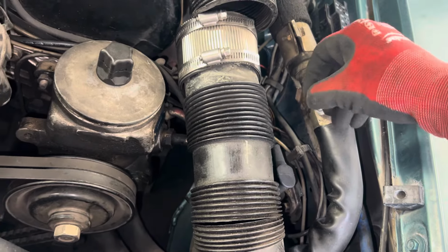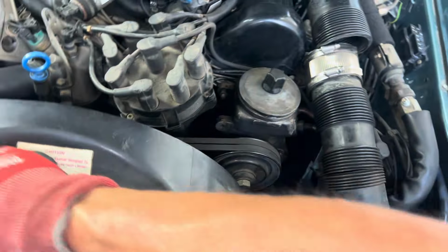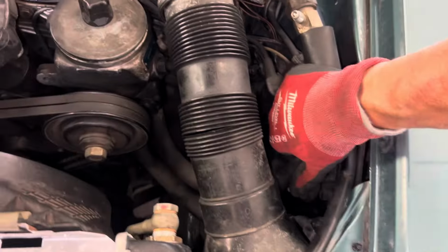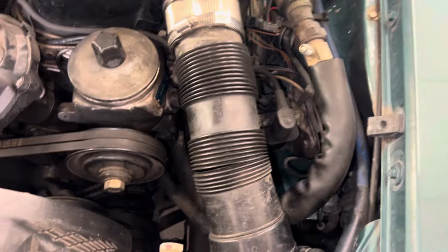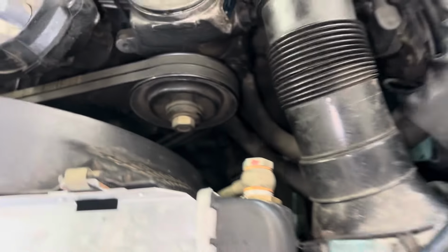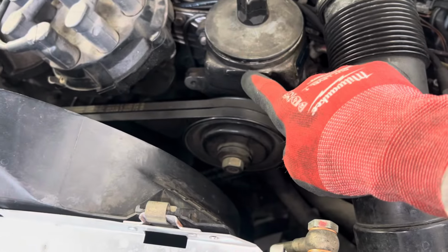There's almost no pressure, probably 25 PSI. Really common. Hoses get old. The refrigerant just goes right through the hoses and the seals. And the idea is to do a visual. I can't tell where all that oil has come from.